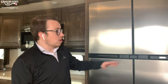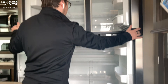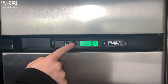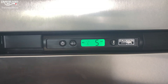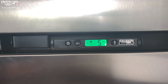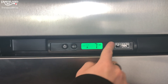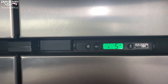Now we're taking a look at one of our largest propane and electric fridges — this one is in a Grand Design Solitude. You have lots of room in there. To work this, it's all going to be off this panel here. There's a nice on button to turn it on, and a couple of different symbols to change it to automatic, electric, or propane. You just sort through here — there's a little electric and propane button that will source automatically, electric first. You can source through just electric or just propane by selecting those individually. There's also a temperature gauge to set the temperature through 1 to 9. Set your temperature to about your halfway point, and that's how you work this fridge.